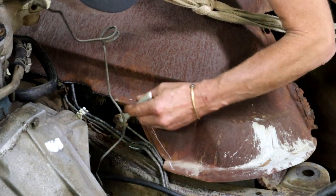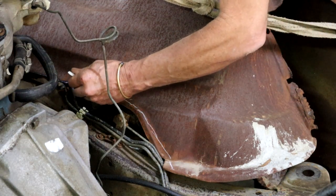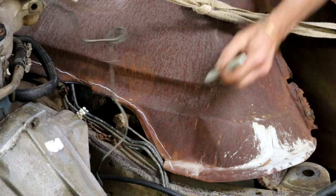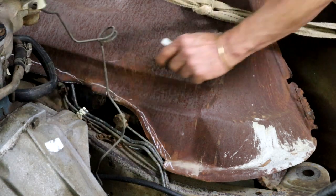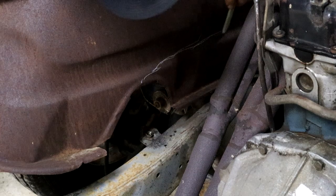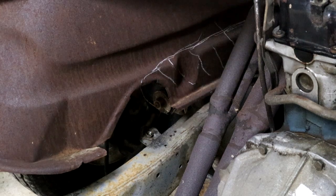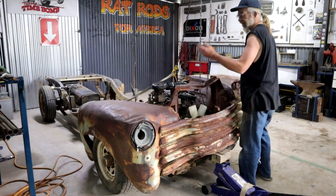I'll smooth and clean it up a little bit - I'm drawing upside down which is a bit difficult. I'll do something like this - this line is supposed to be nice and parallel to the frame. Then I'll do the same thing on the left-hand side and cut it. I'll remove this piece, and because it's fouling right there, once I've got this removed it will drop down and go and sit on the frame rail. So I need to take it off one more time.